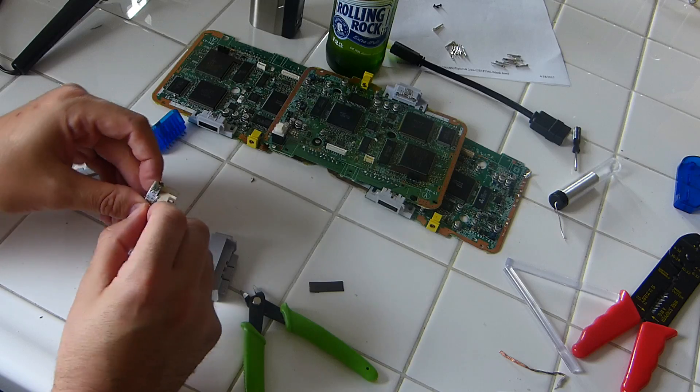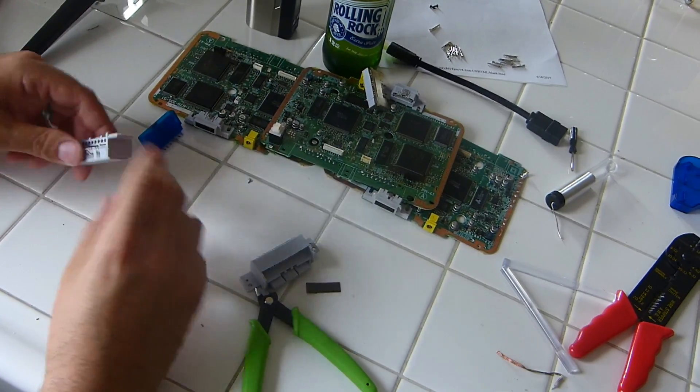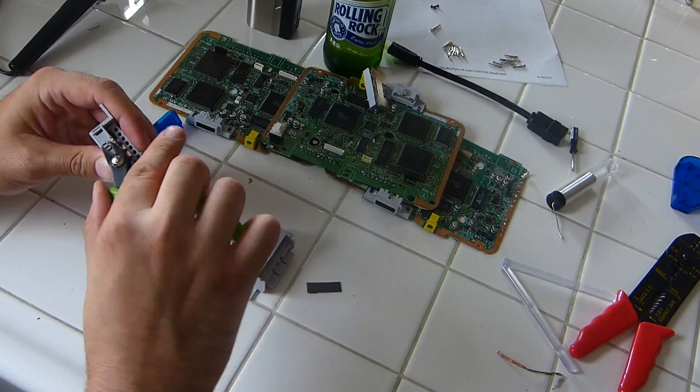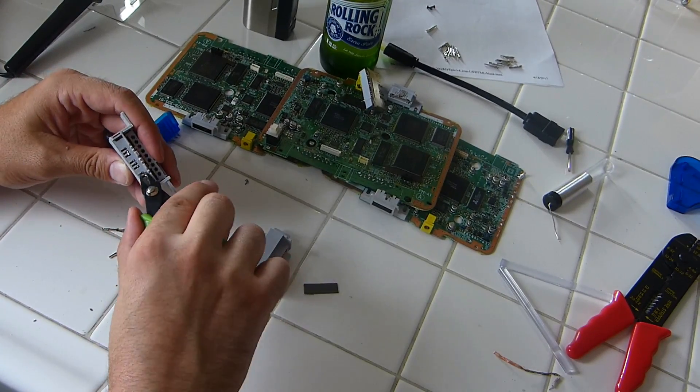You should have nine pins once you remove this piece from your controller port — do not throw those away, we do need them. That back panel piece you can toss in the trash. Here I'm just cleaning up the memory card slot leads, getting that nice and flush.